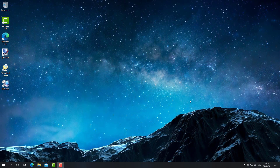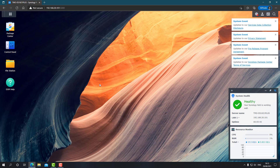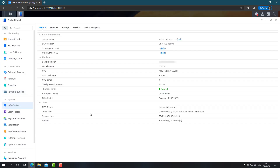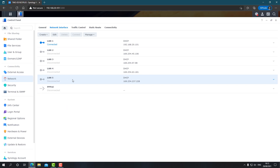Alright guys, we're at the computer. We've placed everything inside our NAS — the RAM, network card, and NVMe drives. All we have left to do is open a web browser and log in directly to the NAS. I want to see my 32 gigs in the Info Center, a fifth network card in the network section of Control Panel, and my two NVMe drives in Storage Manager. Opening Control Panel, going to Info Center — 32 gigabytes of memory. First mission completed! Going to Network Interfaces — and here's LAN 5. The device comes with four built-in network interfaces, and we've added a fifth. Second mission completed.